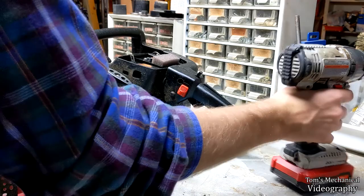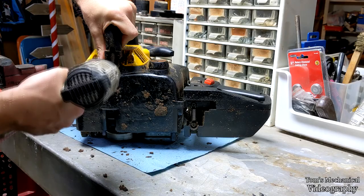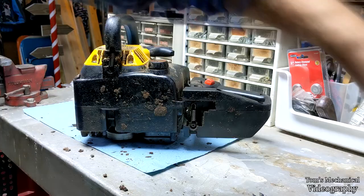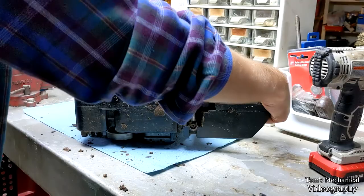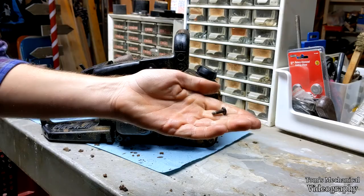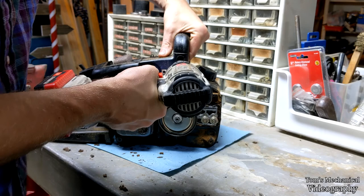and remove one of these two screws from the vibration suspension. Either side, doesn't matter which of these two, but you got to remove one from each spring. Now, flip her over, and you're going to want to remove these two up here to remove your handle. These are a different thread pitch and size than the other ones. That'll allow you to remove your handle.